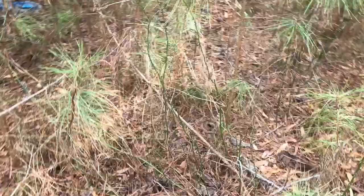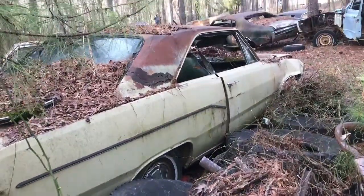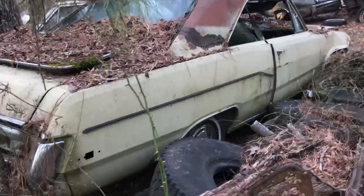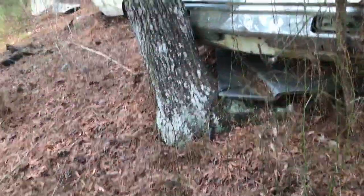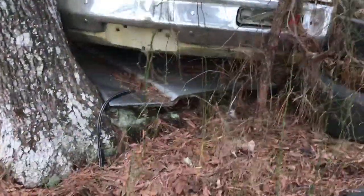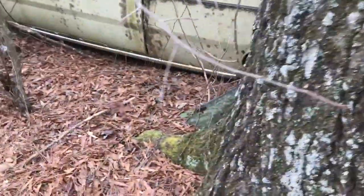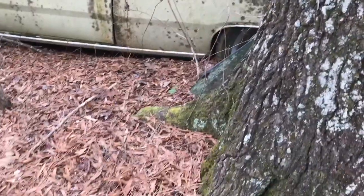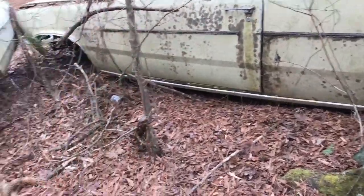Let's see if I can get in here. Briars or something else. The lower quarter's got some rot. It's hard to get around. The wheel well looks to be okay from what I can see. The wheel lip trim — you know what I'm talking about? We're going in here a little bit better. That looks to be okay; this is so hard to get to. That rocker molding looks good — looks real good. It's already halfway off, too.